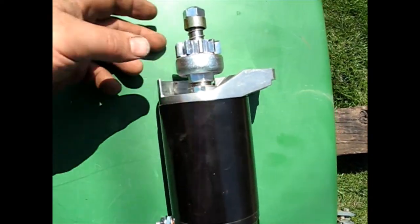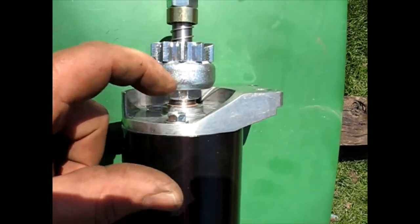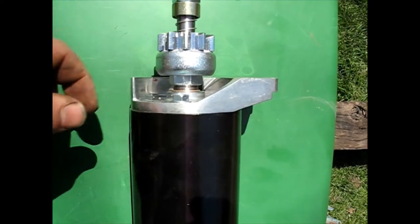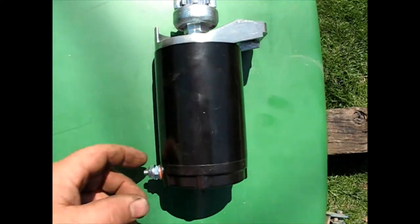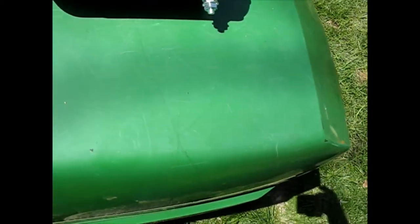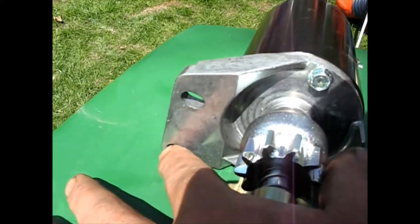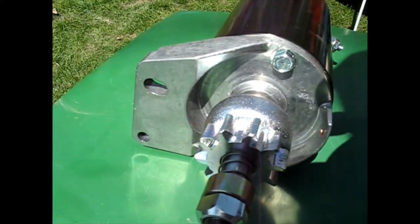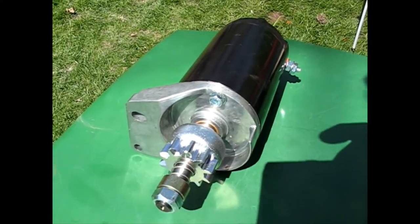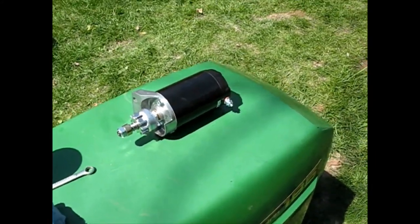Here's what I'm looking at on the starter. I just bought a cheap aftermarket one — I figured it's probably better than what I've got. What I suspect is wrong on the one I've got is this bushing is rusted out or seized on there, because every time I oil it, it seems to work fine for a little bit and then stops again. Looks like one bolt hole is in a fixed position and the other one is semi-adjustable. Looks like two bolts on the inner engine side, so it's going to be a beast to get to.